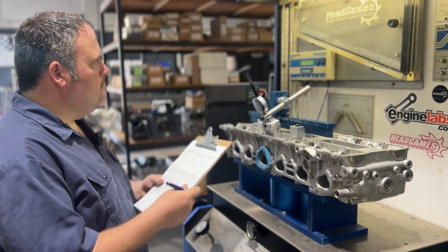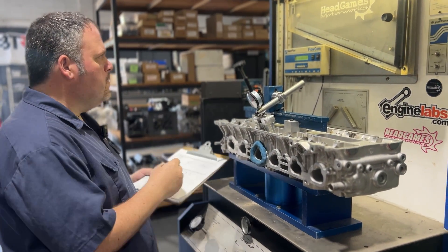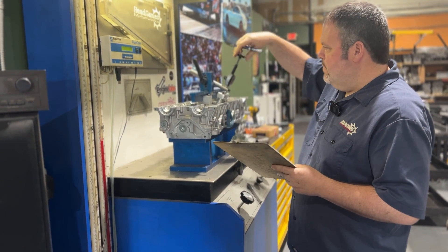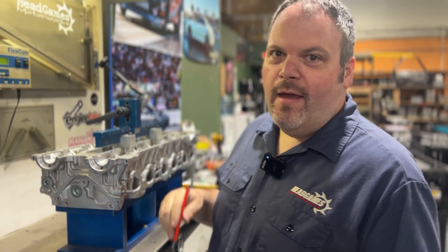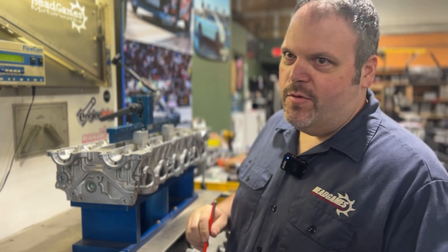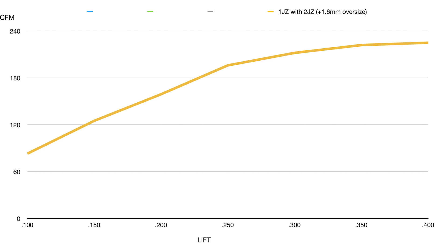Still not woo'd, but I am surprised by what I just found out. Let's go over the numbers now. The first thing you'll notice is the 1JZ with the valve job — it goes pretty straight up in the air, a lot of gains up to 250 lift, which is about 6 millimeter. You really don't have much more beyond that because the biggest cam you can get for a 1JZ is around 9.8 millimeter. When we did the 1JZ with the 2JZ oversized valve, it actually did pretty much the same thing. Now we didn't port underneath it, so we didn't optimize the valve job or the bowl. So you're going to see a big gain.